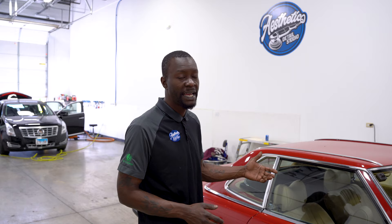Due to this being an older paint, we really don't want to install anything with too many solvents or an extremely high solvent-based ceramic coating, as we don't want to cause any damage to the paint that is left on this vehicle — it is an original paint job. So we're going with the option that is safe, offers ceramic coating protection, and gives it nice durability as long as we maintain the finish.